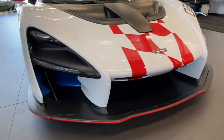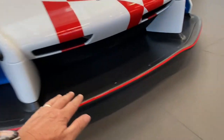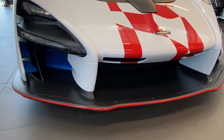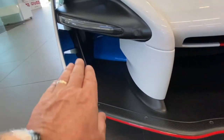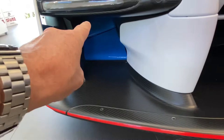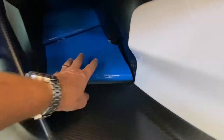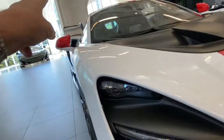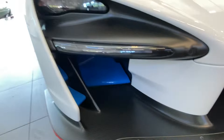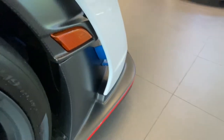Up front is where the real aero trickery starts. You can see air getting sucked into this enormous volume — I'll put my hand in to give you a sense of scale — it's absolutely enormous. The big front splitter catches air and squashes the car into the ground. It then uses aero blades on the side, and these two large ones in here are active. I'll put my hand on them to show how big they are — they open and close in conjunction with the rear wing to equalize pressure throughout the car.